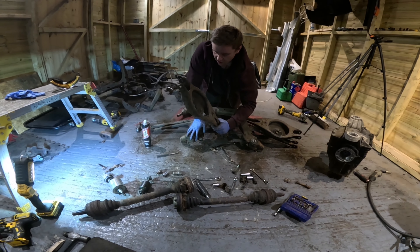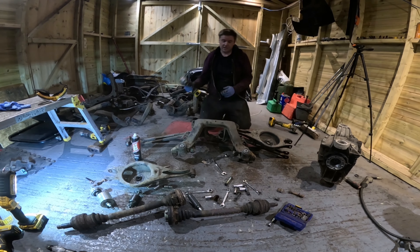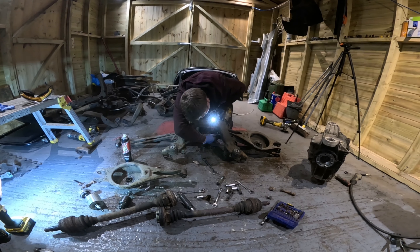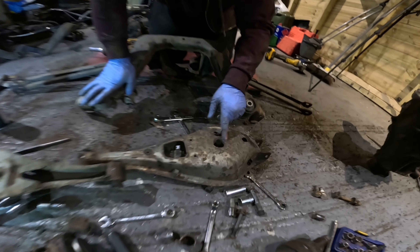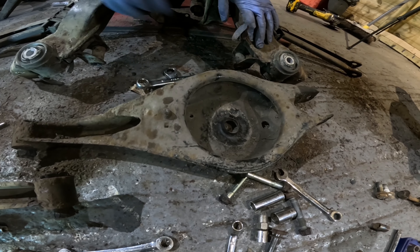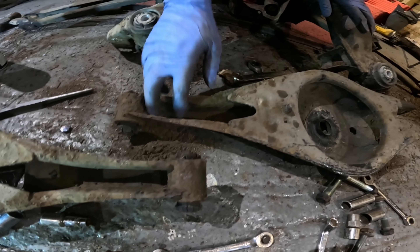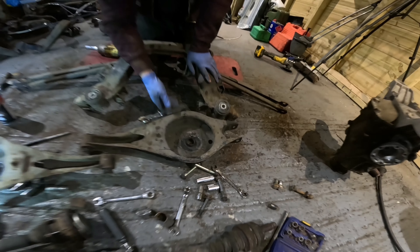Once that's out you can wiggle the spring perch out. We've still got to cut the drop link stub off. This bush is obviously ready for replacement. On the E36 these are steel; on the E46 they're aluminium and they love to snap. Some people run the E36 ones on a 46. When you refit these they are sided - you can tell from the orientation. When fitting polyurethane bushes, note the bush is longer on one side - the arm is sided as well, so take note of that.